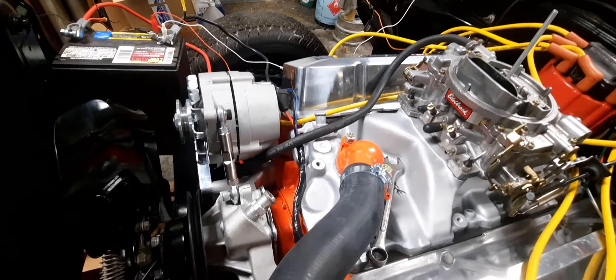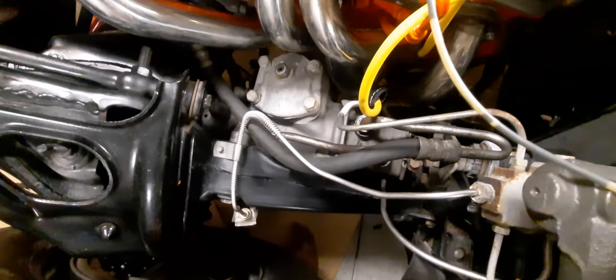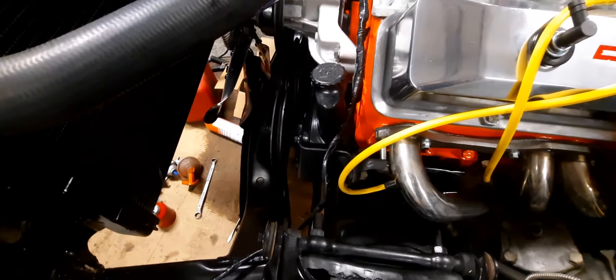Had to lengthen the wiring harness — I ordered a pigtail off Rock Auto, that's why it's not the original white and blue, but it's wired up correctly. Extended the line because it was originally a six-cylinder car. Had to get a new throttle cable and got that buttoned up. Took the old plug wires off my '67 Chevelle to use with the HEI — just to make this thing super simple. Painted the bell housing — it actually looks like polished aluminum. Painted the transmission, it looks good. Hooked up the clutch Z-bar. The power steering stuff actually worked out okay; I think it's off a '69 Camaro.